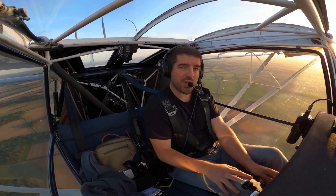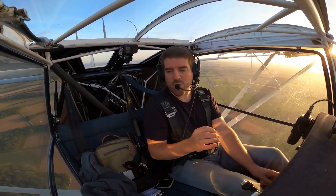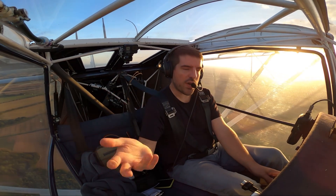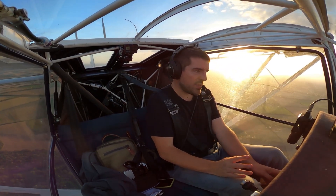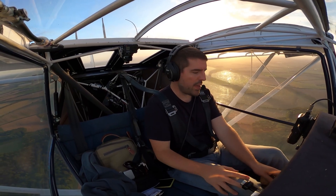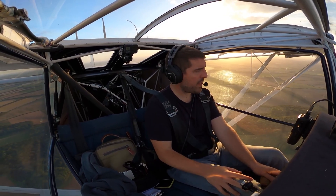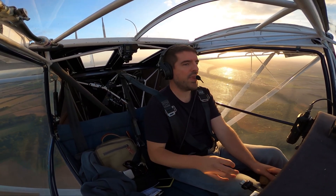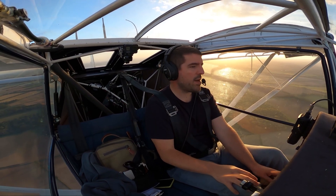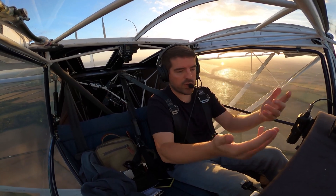The other slight problem I had was that my choke or enricher circuit seemed to get stuck open. I don't think it was stuck open previously, but that would have caused a rich running engine, and I did briefly have that until I adjusted the lengths of the cables that go to the choke or enricher valve. As a side note, whilst I was doing the rubbers for the fuel lines, I decided to do the rubbers for the water coolant as well. So all the rubbers in the firewall forward have been replaced.